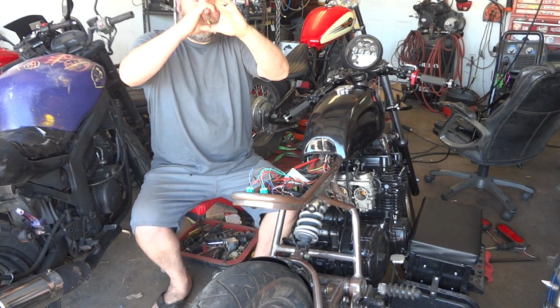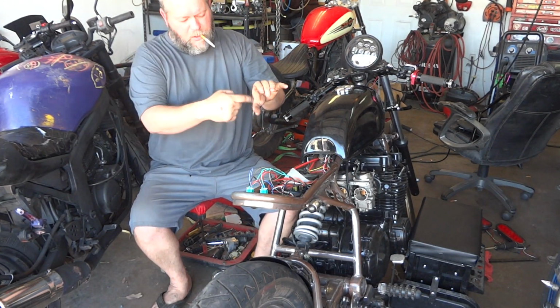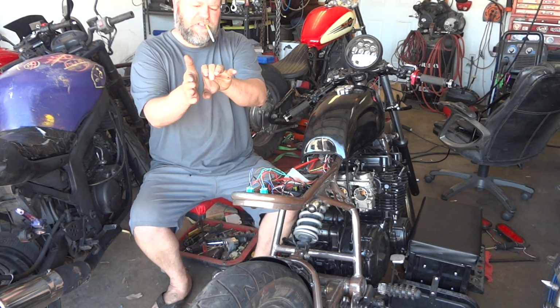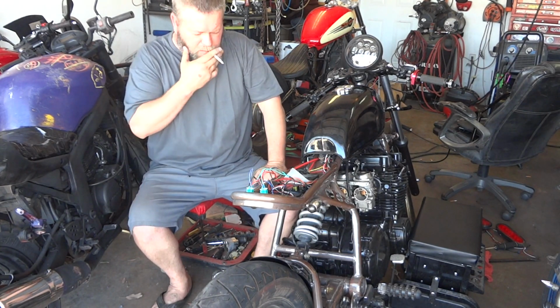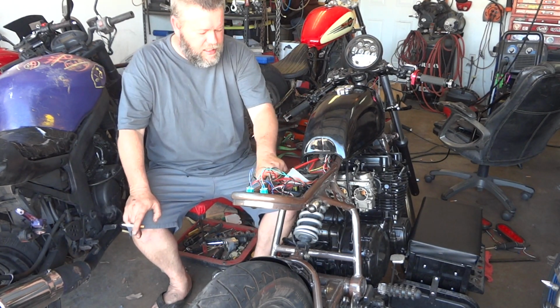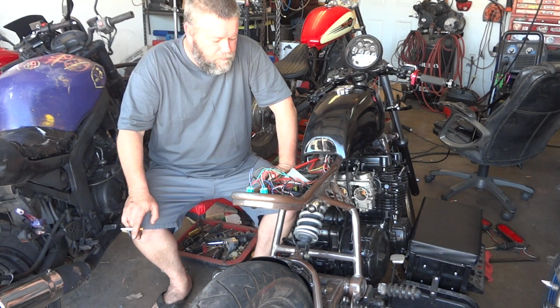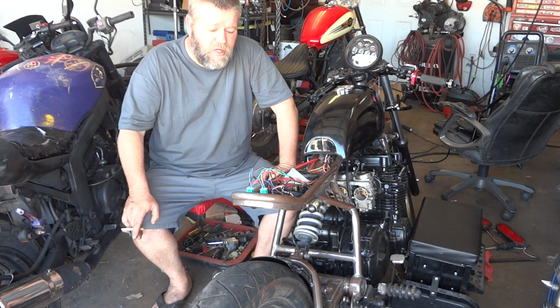that the hole is way off, and the seal, there's a rubber O-ring on the intake boot, and as it goes up to the engine, that hole, I think it's off just a little bit. So it's just causing all kinds of problems, and so we got to get some new intake boots. But other than that, she seems to run real good.